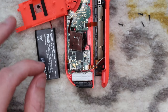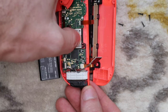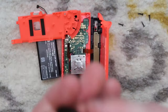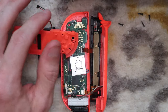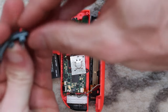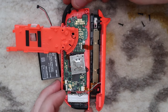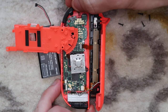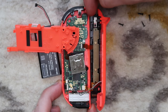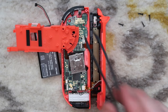Now we're going to take our replacement joystick, push it into the hole — you have to lift up a little bit and press in order to get it through. The R button may pop off; this is easy to fix. The R button has a spring. If it gets dislodged, it goes right there in between the hinge — there is a little place for the spring. When you reinstall it, put this side in first, that spring goes on that little shelf, and the top hooks under the right angle there. It goes back in easily and is held in when this piece of plastic goes on top.